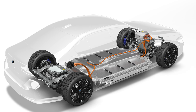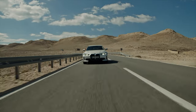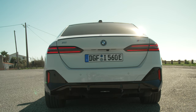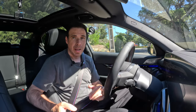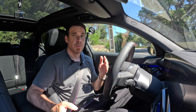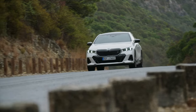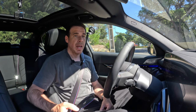Now let's talk about the motors. You have two motors — one on the front, one on the back. It's an all-wheel drive vehicle, but with a different power distribution. Both motors actually come from the i4 and the i7, though they're not the same motors as in the i7 M70's rear unit. You have 340 horsepower going to the rear axle and 261 going to the front, by the 601 PS metric. Because of that extra power going to the rear axle, it's going to give different drive dynamics. I'm expecting this car to be rear-wheel biased — something BMW is known for in their gasoline and diesel cars — and we will see if that's the case.